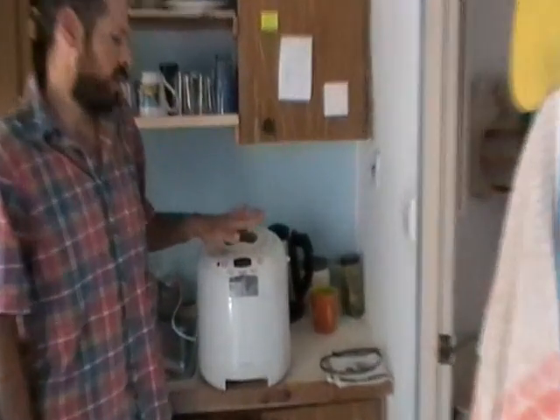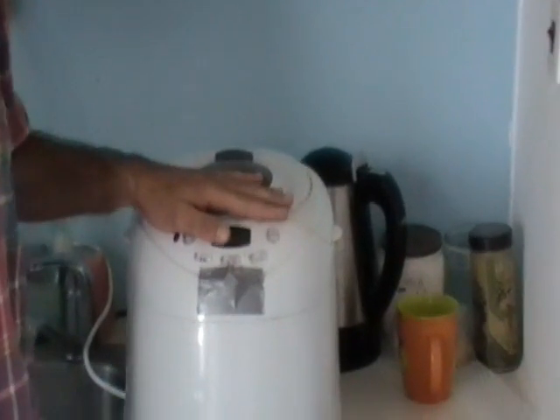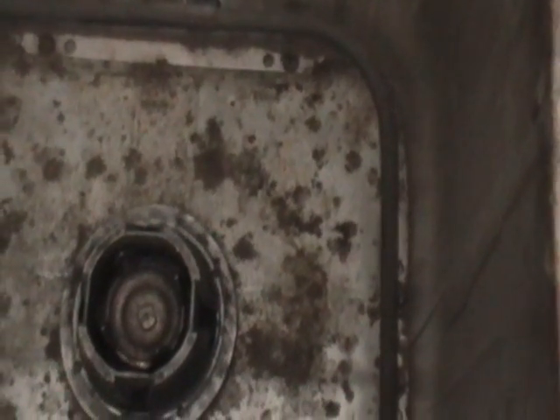I'm going to learn how to replace a belt in a Morphy Richards bread maker, model number 48290. You'd know your belt is loose or torn when your bread maker is working and heating but the stirrer doesn't rotate, although you can hear the inner wheel rotating. If you take it out, you'll see that the wheel doesn't rotate either — that means your belt is loose or torn.